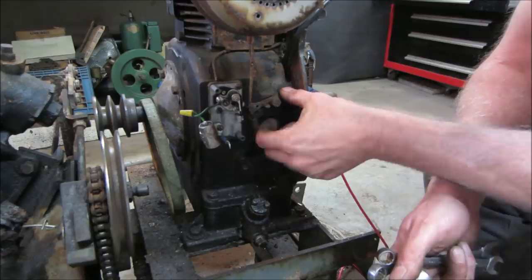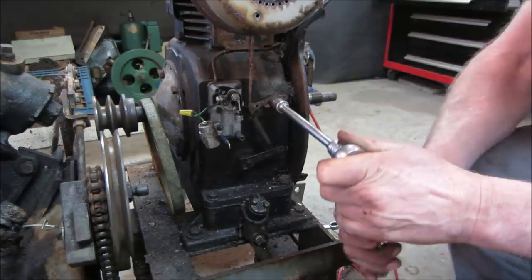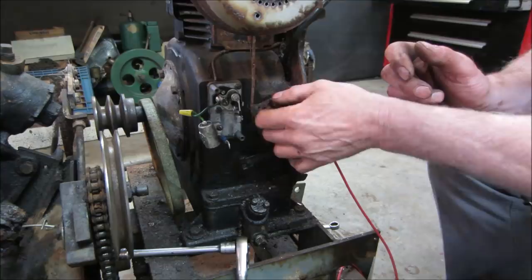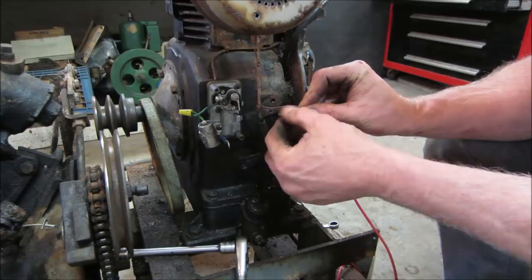I could move that throttle cable, but nothing here moves. Let's, we can free up that pivot. It's either just rusted up or you may have cranked it down because that throttle was wacky. Like I said, that linkage was rubbing right up against the bolt. I think it was on backwards. So that may be due to having governor issues. If it's got governor issues, then we're just going to make it a gas pedal. Run it like a car, you know?